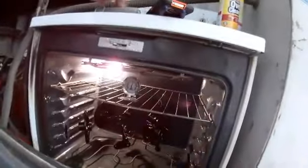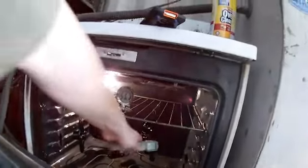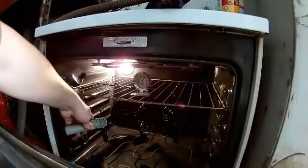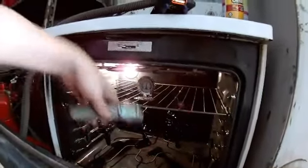So this is the parts that I powder coated in the oven. You can see they're already turning shiny. They just got to reach the cure temperature, which is about 375. Right now, they are 347. So once they reach the cure temperature, they got to stay there for 15 to 20 minutes. And then cut the oven off, let them cool down, and it's done.